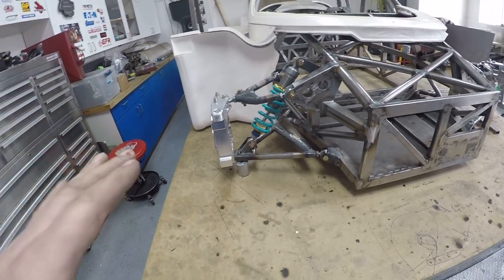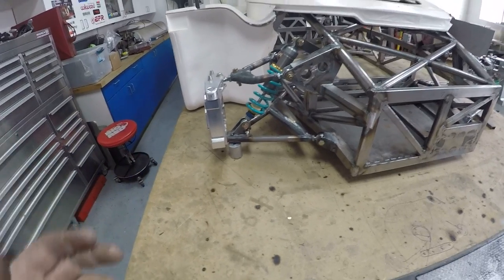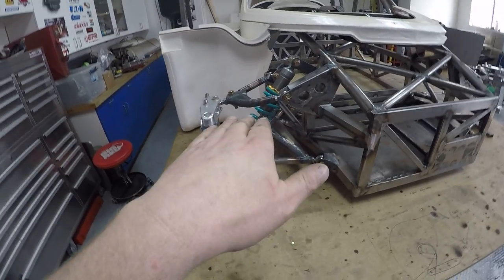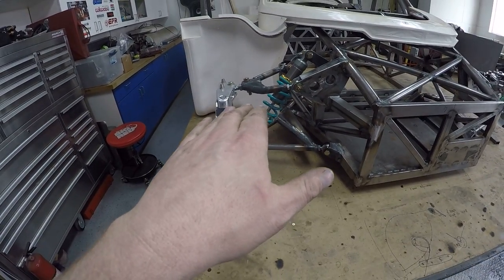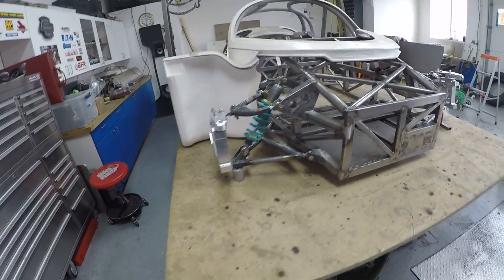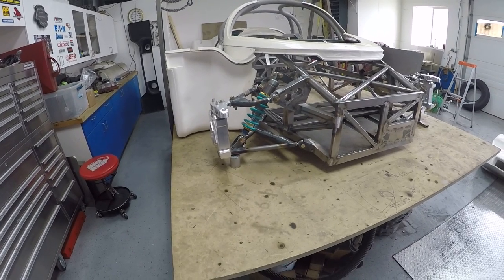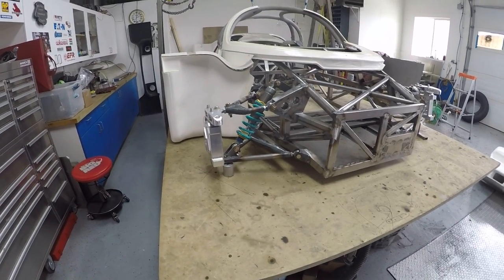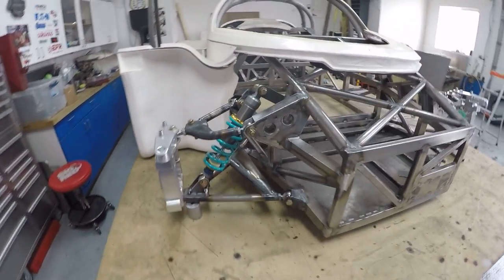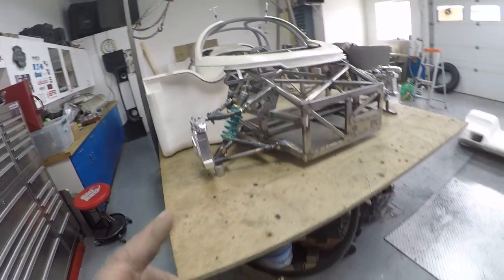With the remote reservoir I can get a three-way adjustable shock. The three-way adjustable allows you to have a stiffer roll setting but also a softer bump setting, because low-speed adjustment covers when the car goes into roll, and then high-speed bump handles going over something in the road. The three-way adjustable should be a nice compromise for a road car so you can go over rough stuff without being affected by a high bump setting.